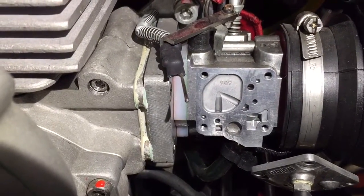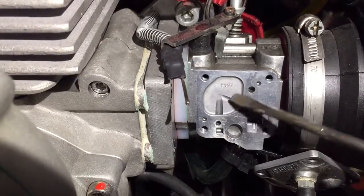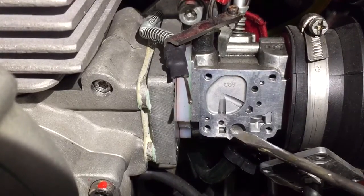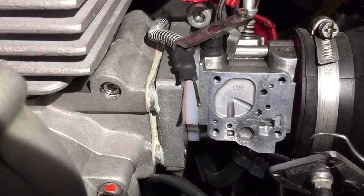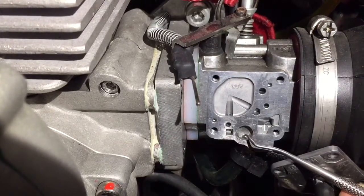You should just replace it once a year. Underneath here you find the cavity for the fuel pump, and down here is the little filter. Inside there there's a small gauze. Get yourself a tool like this or a dental pick, take it and carefully drag it out.